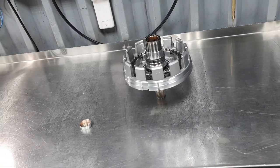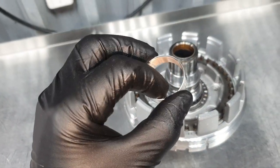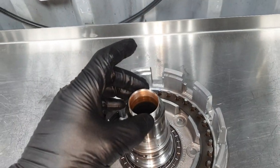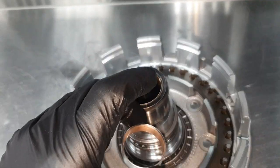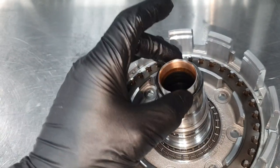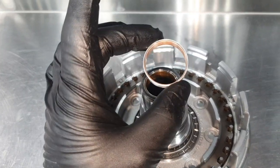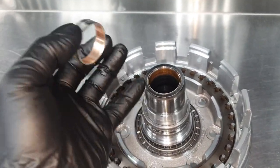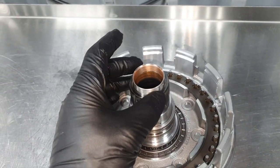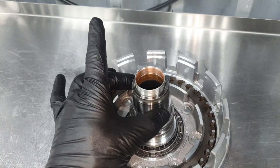Small update on what I'm planning to do. I'm going to show you. I have to go to the lathe machine and fix one adapter for that one, an aluminium adapter, to not hurt it. So it comes a little bit more down. Yep, so I have to fix a lip. I'm going to get a sample of the other one, the other pipe, call it as you like. I'm going to fix one nice adapter. I'm going to warm it up, and then I'm going to put it inside.